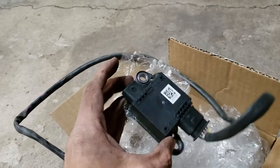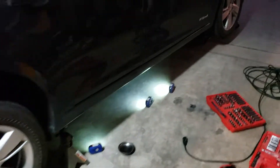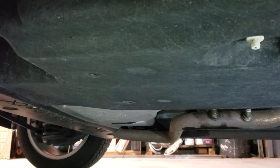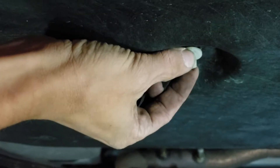Here's the module that goes along with it. What you should do is jack up your car. These Cruzes sit a little low, so give yourself lots of room in the front and the back. Underneath you'll see this composite panel. If you've changed the diesel fuel filter, you've taken this off before. There are 10 millimeter plastic nuts — a whole bunch of those in a circle. Take all those off and this panel will come loose.